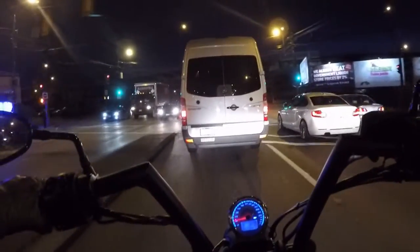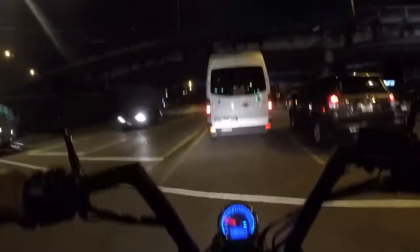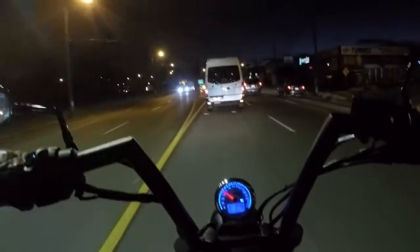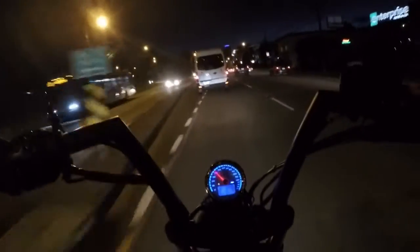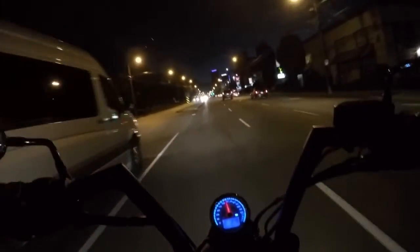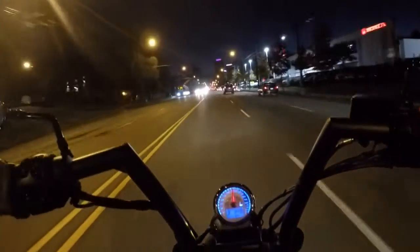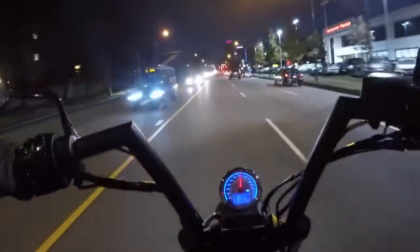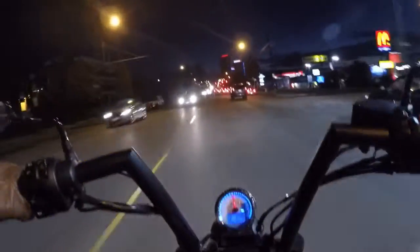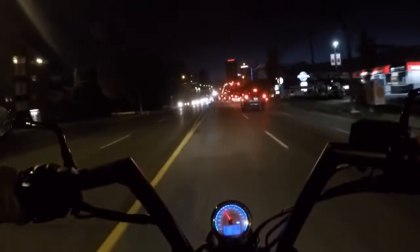Now, that being said, that's the only thing I do have some troubles with. For instance, a lot of times when I'm coming off the highway or off a fast section to an intersection where I'm going to turn, that's usually where it happens the most for some reason. If you go into first and you're going really quick, and you're holding down the clutch, just getting into first because you know you're going to coast and then brake, it'll sometimes do this almost electronic shutoff. It feels electronic.